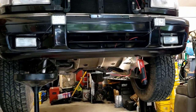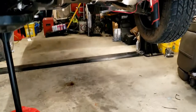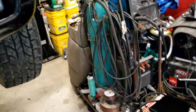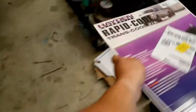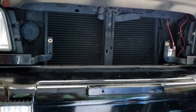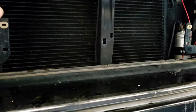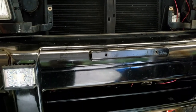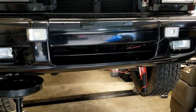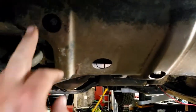With today's transmission service, we're also adding a transmission cooler. The part number is the Hayden part number for the trans cooler. We're going to install it right here before the stock cooler in the radiator — that way it'll help cool everything down but not get too cold, which would be bad for the transmission. Stay tuned and we're going to get right into the job.